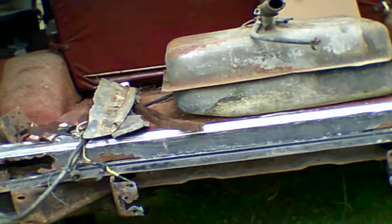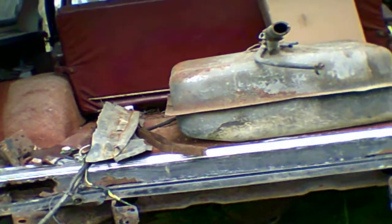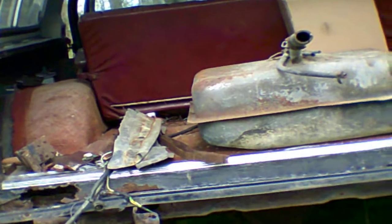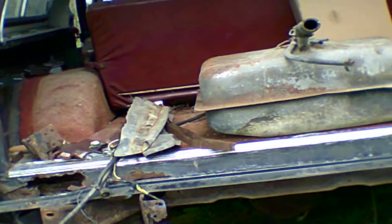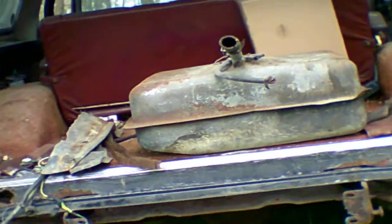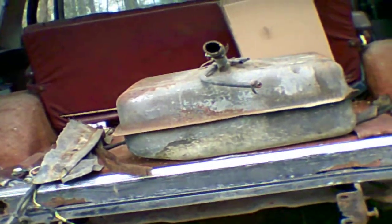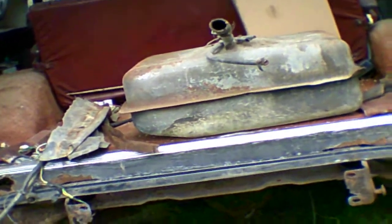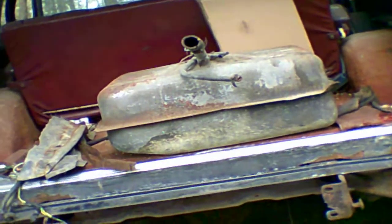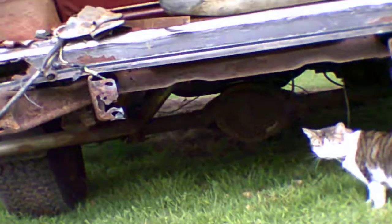So this is Rusty. Like I said, I don't think Brian's going to get upset. While you have it apart, it's the time to replace stuff — the power booster is shot, the master cylinder, and most of the brake lines are totally wasted. That stuff's all going to get replaced while it's apart and you have access to it. I'm going to completely disassemble most of the front end to get at that stuff and get the frame coated, because it does have quite an extensive rust problem.